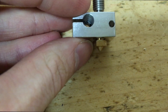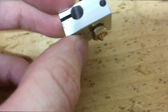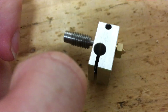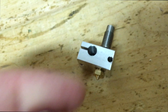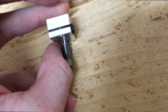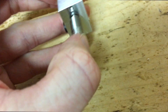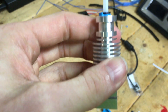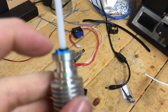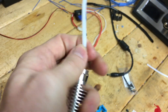In this step, I inserted the nozzle to go about that distance, then inserted the heat throat and screwed it in place. Now that they're both in place, I'll tighten them so I can tighten the nozzle up a little bit more. Then add the thermal paste to the heat throat. Once that's done, I can screw the heatsink on. Then I can start adding the heater and thermistor and attach it back to the E3D mount on the printer. Heat sink, thermal paste, and nozzles are all connected. We put the PTFE tubing inside here with the collet piece and the plastic fittings. So now it's assembled.